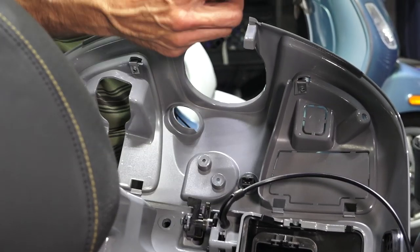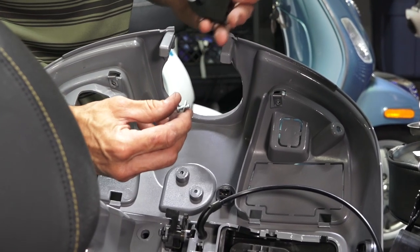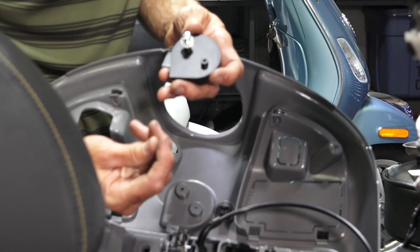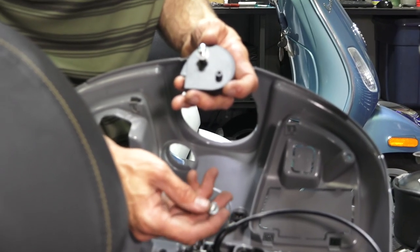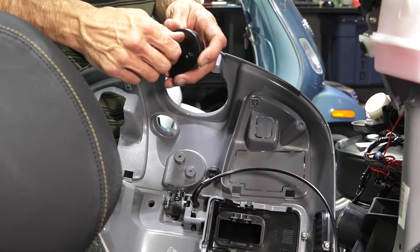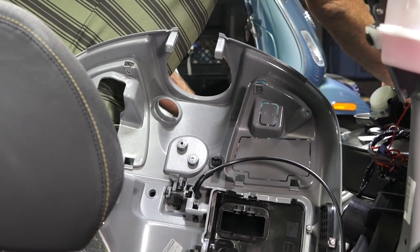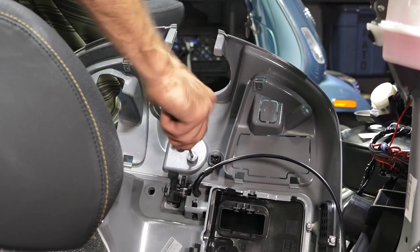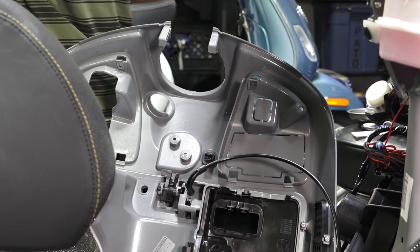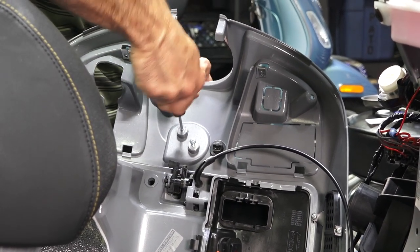The new one's going to go in. One thing to keep in mind: sometimes these holes are a little on the small side, so check fitment — you can see they're not going to go through. The holes for the metal bag hooks always use M5 style fasteners. I added these washers; they normally don't come with washers. Sometimes the bag hooks also have hex style fasteners on the back. You can either take a drill and chase it with something slightly larger than five millimeters, or take a screwdriver and ream it out. It doesn't need to be too pretty — just enough to get it through.